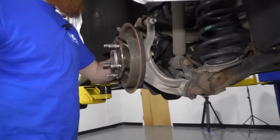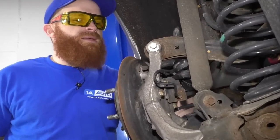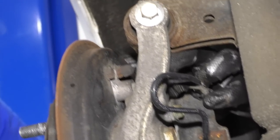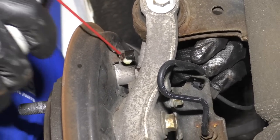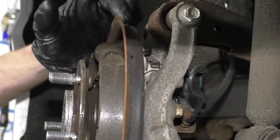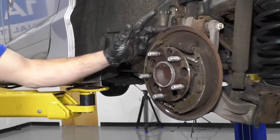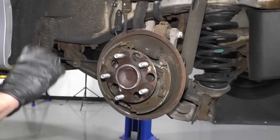Something important to mention — because we're going to be taking the line off the rear of the wheel cylinder, right back here, you can see the bleeder screw and the line. We're going to spray this down with penetrant, whatever your choice is. Give it a little spritz, give it some time to soak. Once we're done, we'll come around to the front and clean off the working surface as best we can so we have a clean area for everything we're going to do.